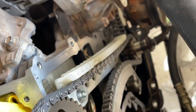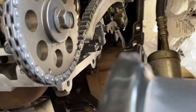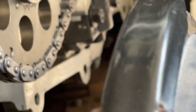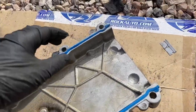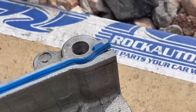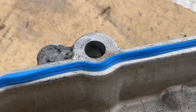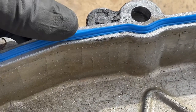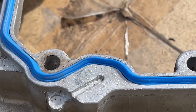This is a good time to put oil on the chains themselves and let it kind of drain into the oil pan, then take the plug off the oil pan and let it drain out if you have any debris. As for the timing cover, I got my Felpro brand gaskets — I'll put them in the video description. They worked really well, they were thick, they lined up right as they should, and I was very happy with how they went in.